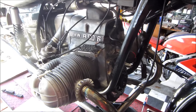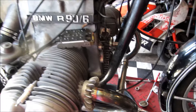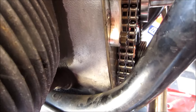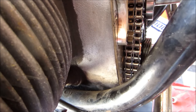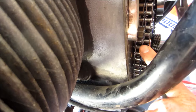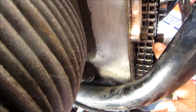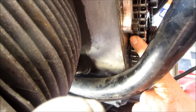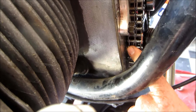We're working on a 1974 R90 and we put a new timing chain in it. After '79 they started using a timing chain with a master link. Because it's so long — it's dual chains — it has to go in the back, and you have to get the clips in this little space. I'll show you how I'm going to do it.